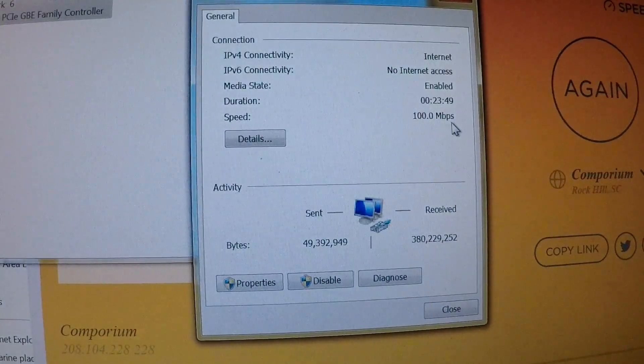So it's my onboard Ethernet card on my motherboard — that is the problem right there. Obviously the switch was also a problem, but it's clearly my motherboard's Ethernet port as well. I could probably get a PCI network adapter or Ethernet card that's 1 gig capable. I'll do another speed test on my other computer, which is actually 1 gig — 1000 megabits per second — capable, to show you the results.